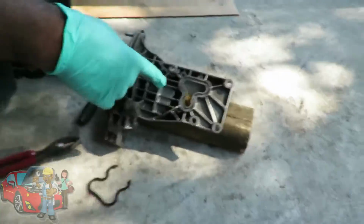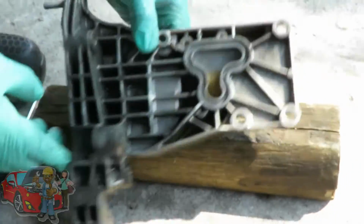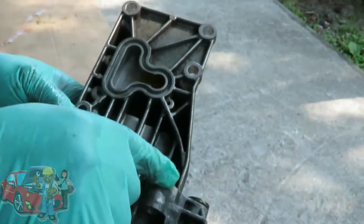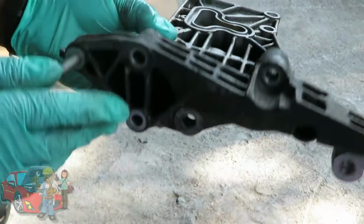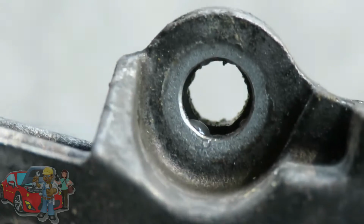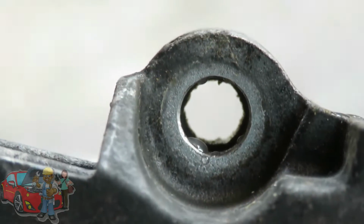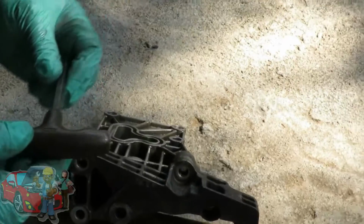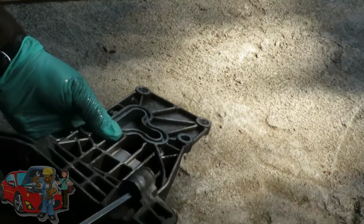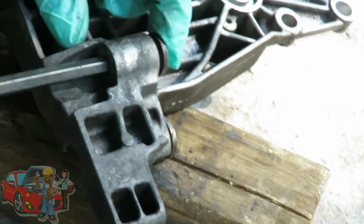Be right back. Alright guys, I got the gasket out, I cleaned it up, and check this out. Now here's those shims that are adjustable, it turns. I don't know if you can see inside one of them, but it actually looks like you can get an Allen key in there. So I got an 8mm Allen key, and what I did was put it in there, and look at it. I can adjust it. I can turn it.